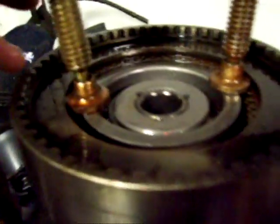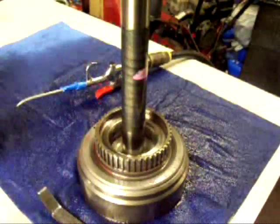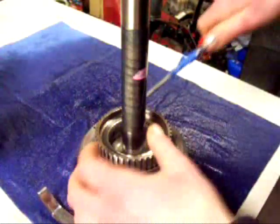I got it on — it's good to go. I can take these C-clamps off now, and the forward clutch is pretty much done. Forward clutch is all assembled. Now I can go ahead and give it a little air check to see if it works. The apply hole is right there.